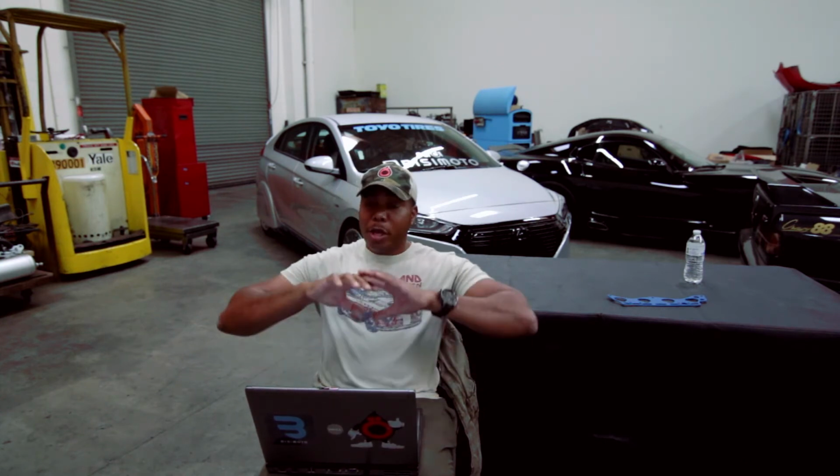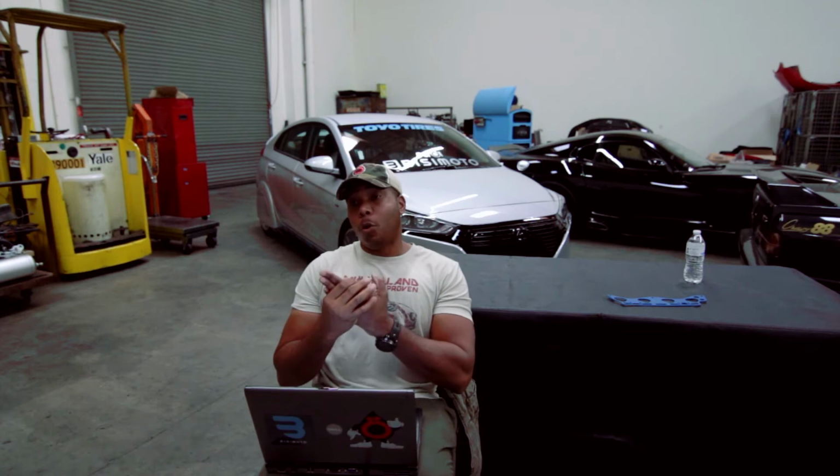So that being said, if you're thinking about gasoline versus E85 versus methanol, those three fuels have different caloric content. When we think about using a unit of air and how much fuel is used to combust that unit of air, how much heat is created by that air, methanol reigns supreme. E85 is a close second, and of course petrol, or E10, or regular gasoline you get from the pump, is the lowest of the few. Then we don't get into kerosene or toluene or acetone or stuff like that. But those three are the most popular ones.